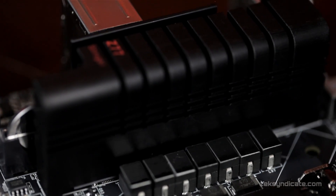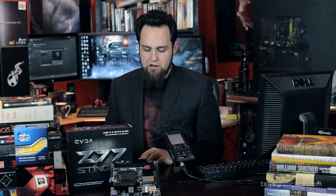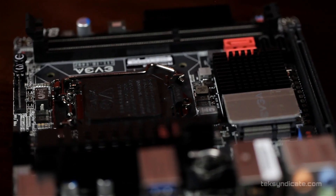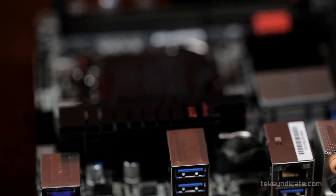You can see there's a large heatsink on the voltage regulators. The audio on this is the Realtek ALC 899, and it sounds quite nice — Realtek is starting to sound almost as good as dedicated audio, not quite, but almost. All around the board you'll see solid-state capacitors, and the NIC on this is an Intel NIC, so it's absolutely loaded for an ITX board.